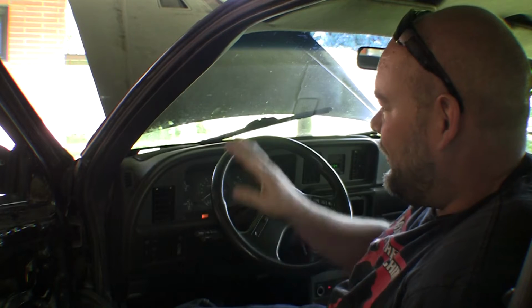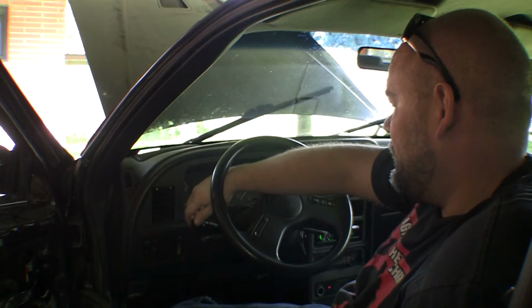Okay, I'm back on the '88 Ford Thunderbird TurboCoupe, and I believe this is a common problem, and I think it's going to be a fairly easy fix, I hope. If you can hear that buzz, that is actually the windshield wipers getting stuck and not being able to return. They're all the way off on the stock right here, and then as soon as I turn it on, it's on delay right now. The buzz goes away, and eventually they'll wipe and come back down.